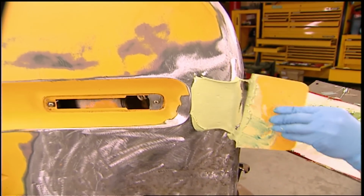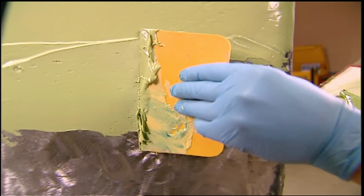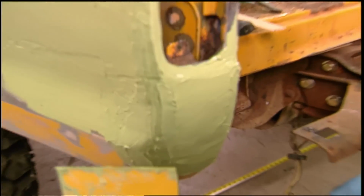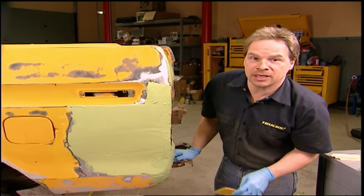After grinding the stud welds off, plan on at least 2 applications of filler. If you try to overcoat your repair, you lose control of the thickness and it tends to run off onto the floor. Cool. Let that set up about 10 minutes, then work it down.